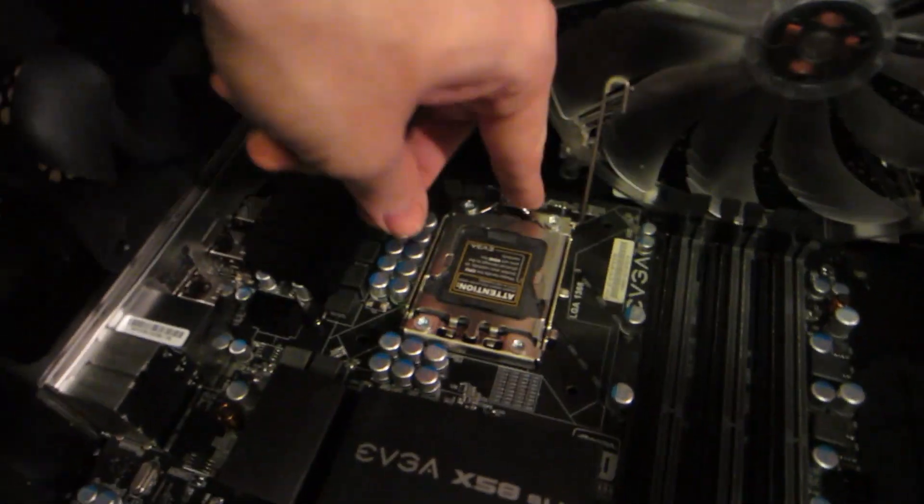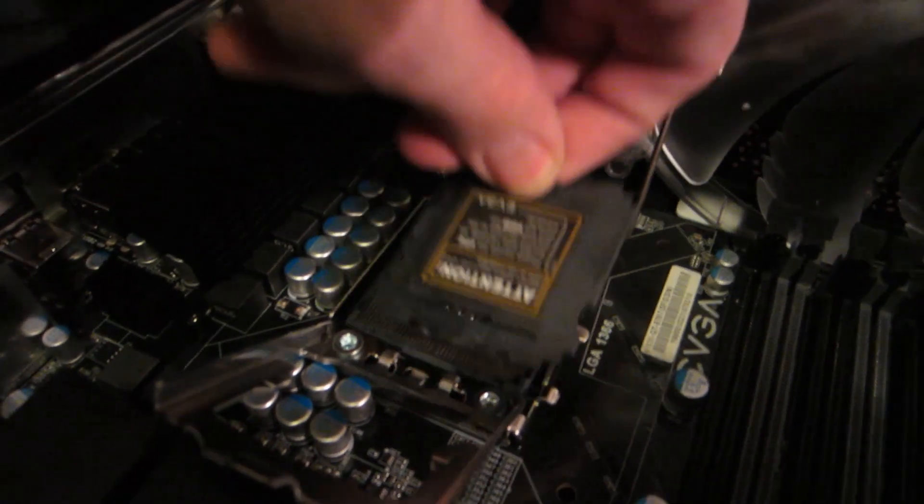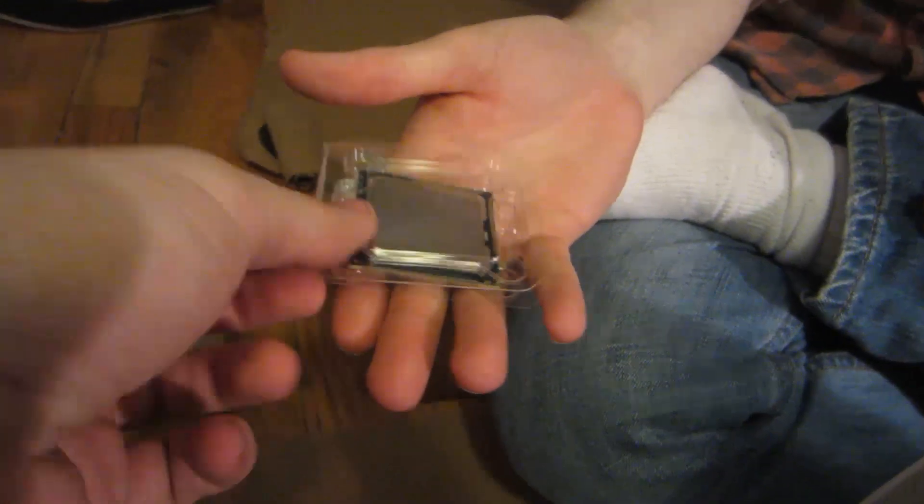What you do now to get it in there is you pull this latch up, then you lift this piece here. Now you pull this up after unscrewing that latch. If we look in here, I'm going to take this plastic placeholder out — that is where you seat your CPU. Now what you're going to do is study the CPU for a second, and you're going to find there's a notched corner that matches that space in here. See these little notches on the side? We want to find one of those notches. See how that notch is there? Notches line up.